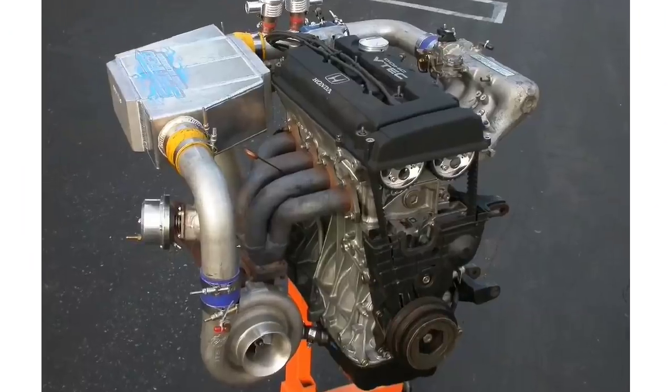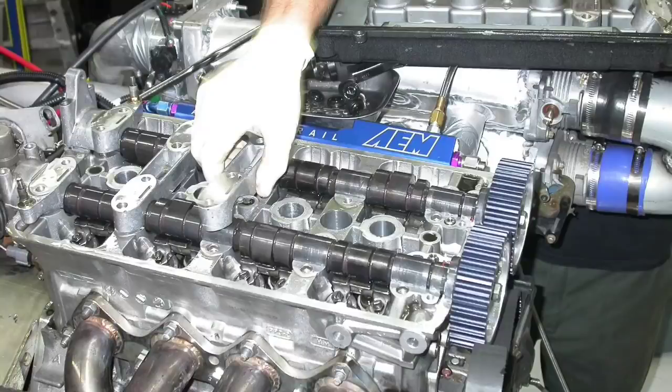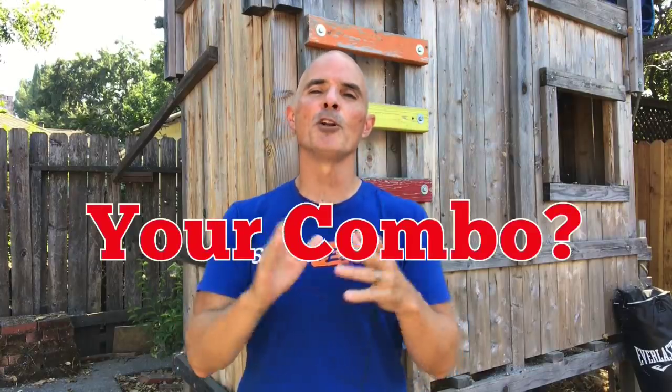What'd you think about the test on our turbocharged B16A post-big-bang test? These Honda motors really impressed me — they just love boost and you almost can't put the wrong camshaft in them. All you have to do is add boost. What impressed me most is that I reused the stock head bolts — it had a factory head, factory intake, basically just a good turbo and decent-sized camshafts, and all we did was turn the boost up. It made over 500 horsepower. Let me know in the comments how much power you've made with your B16s. I'm Richard Holdener — thanks for watching, like, share, subscribe, and I'll keep on testing.